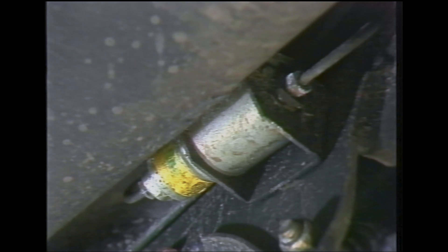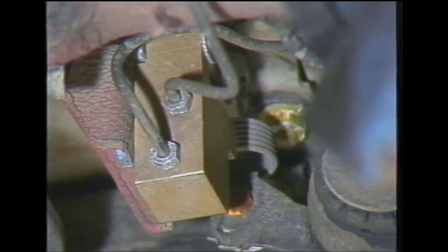As well as ride comfort, braking has been further improved on the Audi 200 Quattro and the Audi 100 with the introduction of a retardation-sensitive brake pressure regulator. This unit works in conjunction with the original load-sensitive regulator and limits brake line pressure to the offside rear wheel.